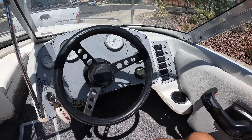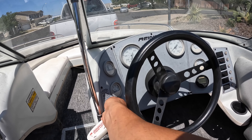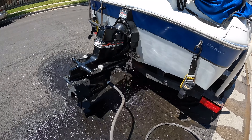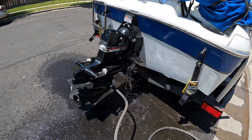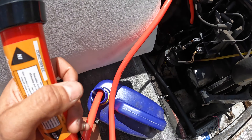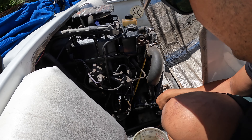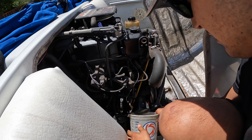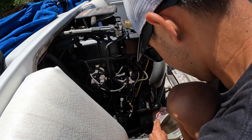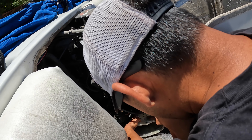Got the water on. It's in neutral — give a little gas — but first let's run the blower. Got a cheap siphon pump here, put that on top of where the oil dipstick goes, and I'm just going to pump the old oil out into an empty gallon jug. Going to put a painter's bucket under there to catch all the oil.